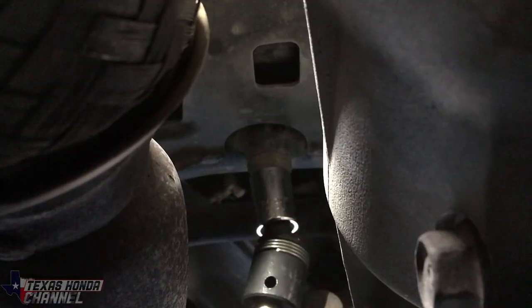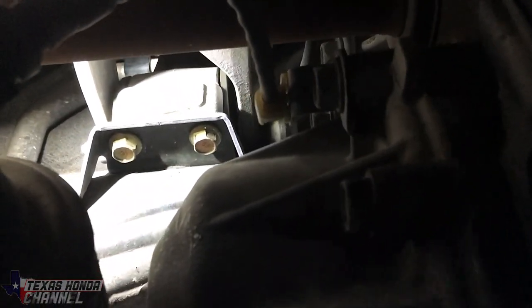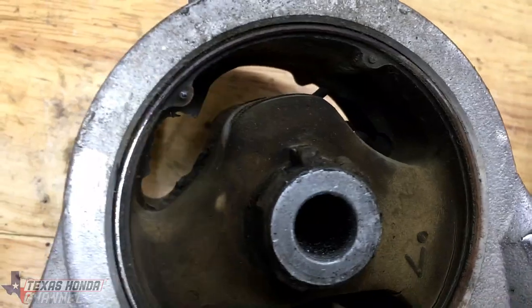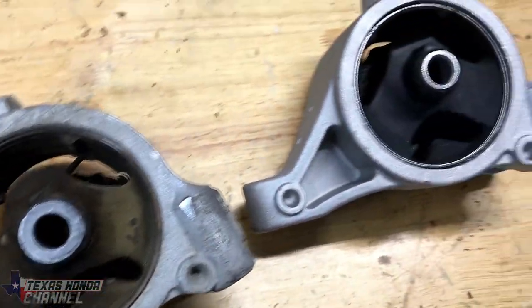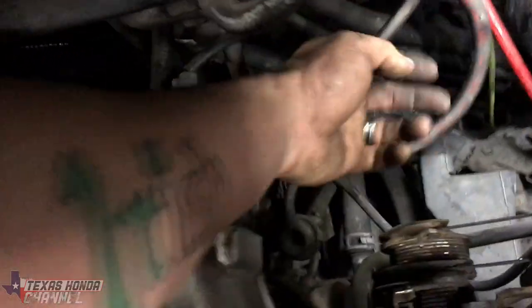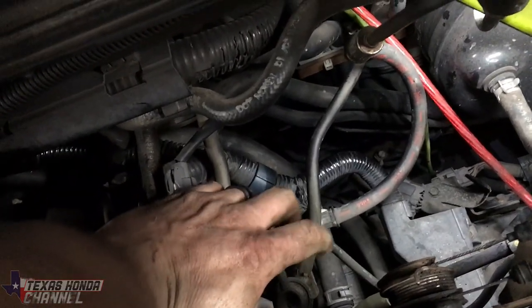After you get both of those 14mm bolts done, move back and you'll see there's a third 14mm bolt — a longer one. Go ahead and undo that one as well. Then all you have to worry about is that 17mm bolt from the top. I got it out — wanted to show you it's starting to crack right there. This one's not as bad as I thought it would be, but we're replacing it anyway — it's definitely stiffer. The easiest way to extract it after removing the 17mm is through here, maneuvering and wiggling it around until it slides up and out. My arm is pretty scratched up from it, so just be prepared for that.